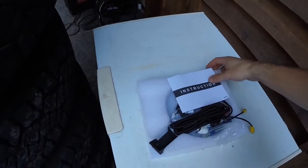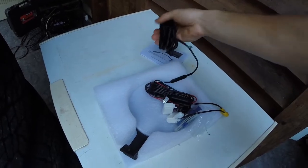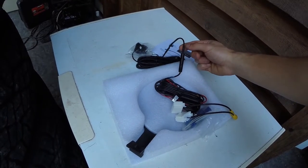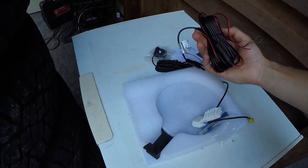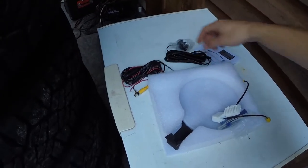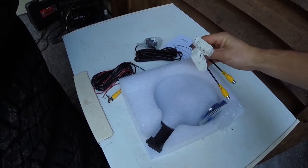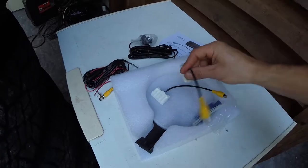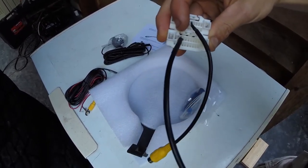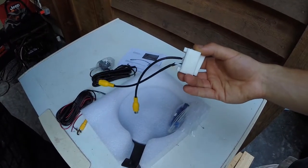There's really nothing too special about this kit. It came in a no-name box with a little instruction manual. Your reverse camera comes with plenty of wire length and has a little connector that you can disconnect so you can feed the smaller connector through the fifth door. This routes through the cab up to the front to plug into the back of the radio. It also came with two different video jumpers that plug into the back of your head unit — you can see they're actually pinned in different locations: one's slot two and three on top, and this one's slot five and six.